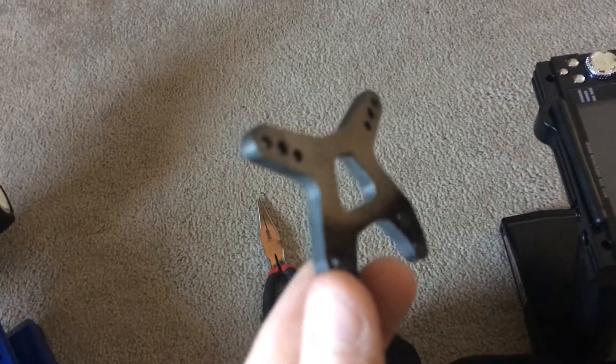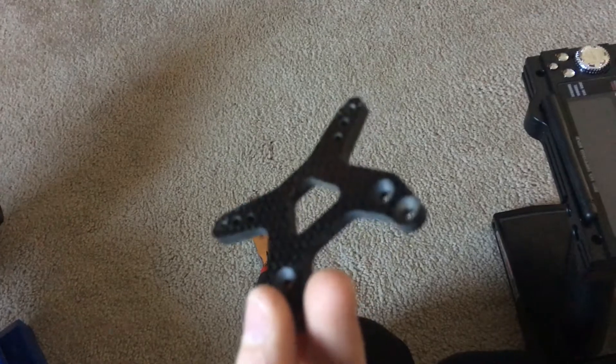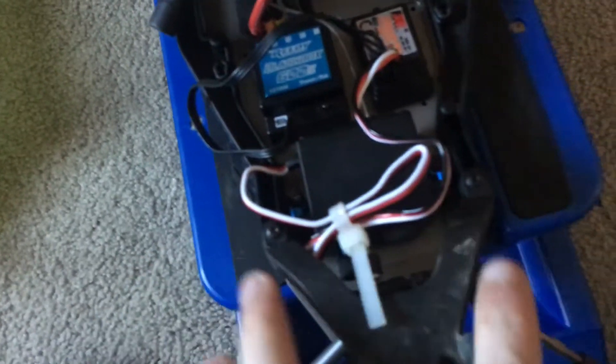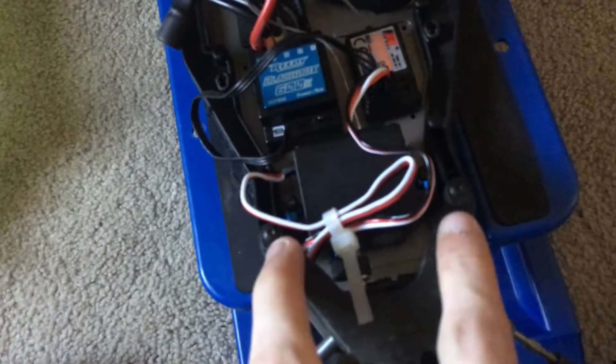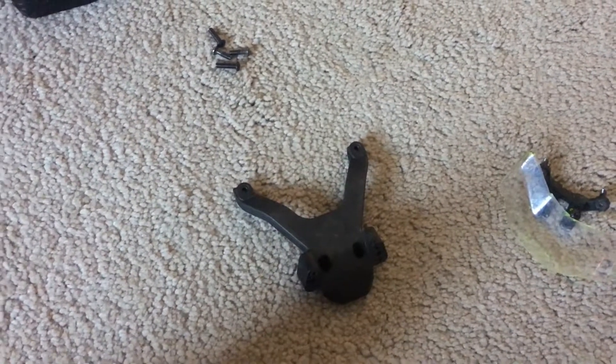Turn it a little, see how shiny it is. Nice shiny carbon fiber, all just from one spritz. Sticky Kicks — this ain't sponsored, but I love their products, so I have no problem showing them off. Just going to put the screws in there, make sure I don't lose them. Next, I'm going to take off this top plate, which is held together by two screws here and two in here. Same thing — spray and wipe down.